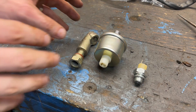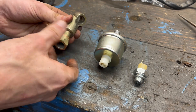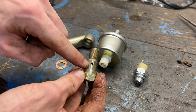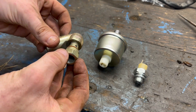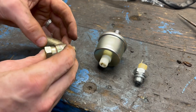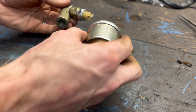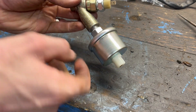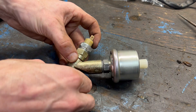Before we get into the car, I'm going to show you how to assemble this on the bench so you're not struggling to see how it gets assembled down in the car. The first thing we're going to do is unscrew this bolt here and take off these copper washers. You can see it's like a banjo bolt in a sort of way. We're going to put one of these washers on first — these are just crush washers to seal it — put it through the hole, and then when we go to screw it into the car we'll take another copper washer where our current sensor is sitting. Then we go on top with that same banjo bolt, and our big sender that's actually going to read the oil pressure is going to go on the arm that sticks out. These all have crush washers on them, just not copper, and we're going to tighten those down.